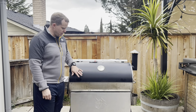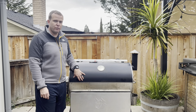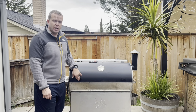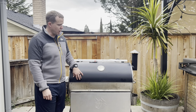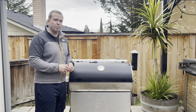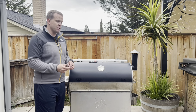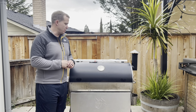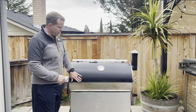So for our application, the install is pretty straightforward. Your bullhorn handles, if you recall from when you assembled your RT700, are simply attached through the lid with two Phillips headed M6 by 1.0 screws on each handle. For the installation today, because we actually lost one of our screws, we'll be using an Allen head T-handle wrench because we've replaced ours with some stainless steel cap bolts that use an Allen head. So for the installation process, like I say, you'll want to start with removing your handles.